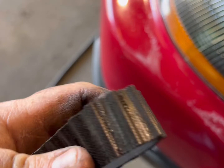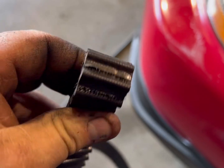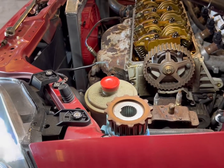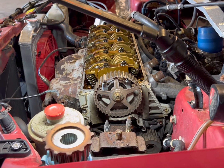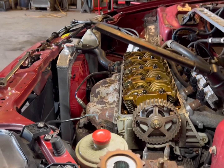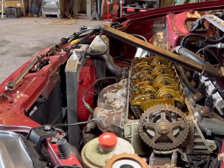That's why you need to do your belts. If you get one of these cars and you don't know if it was done by the previous owner, at least pull the cover off and double check, or just get a belt and put it in — buy the whole kit, it's not much. That'll save your motor. They're interference motors, so usually when this belt breaks you'll bend some valves. Though sometimes people get lucky — when guys came into the shop with a broken belt, we'd throw a belt on, re-time it, and sometimes it fired right up and ran perfect. But nine times out of ten it bends the valves.